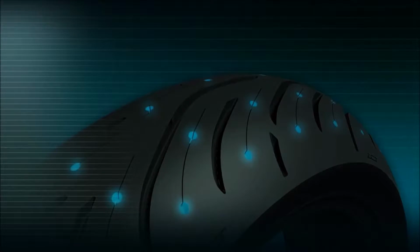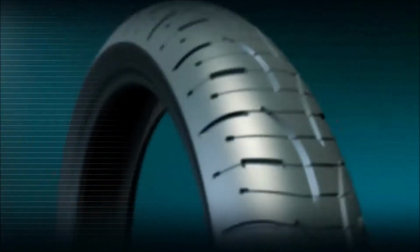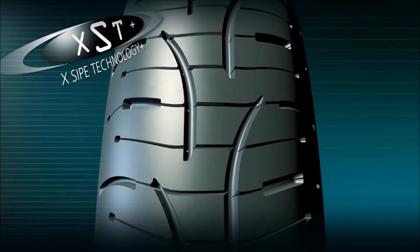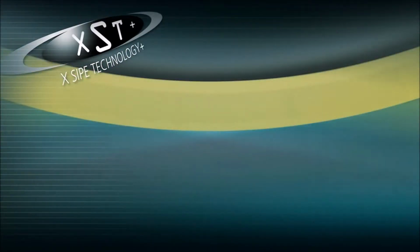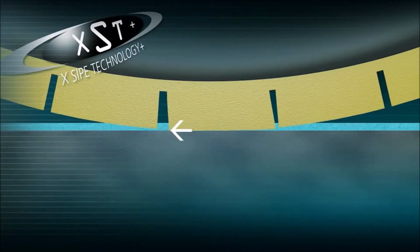Circular recesses distributed along the tread grooves also improve water drainage from the contact area. These reservoirs are designed to collect water momentarily before channeling it away from the contact patch. The Michelin Pilot Road 4 uses X-Sipe Technology Plus. On the front tyre, sipes are cut into the tread at right angles to the direction of travel and at a 15-degree slant. This siping greatly improves grip on wet roads. Because the edges of the sipes cut through the film of water, the rubber comes into dry contact with the road and can grip more effectively.